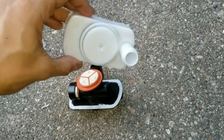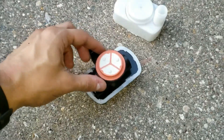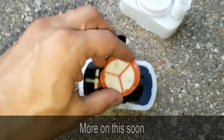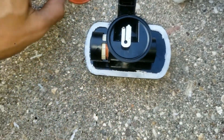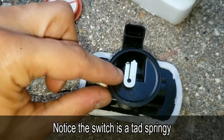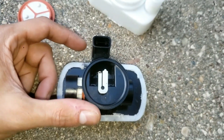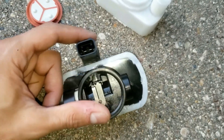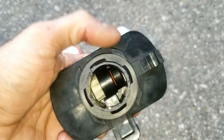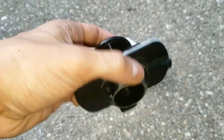Let's take a look at this now. This is the ESIM housing. This is the diaphragm, right here. This is the vacuum switch, right here. This is where the wire harness connector goes into. This is really just the other side of the ESIM — the cover.